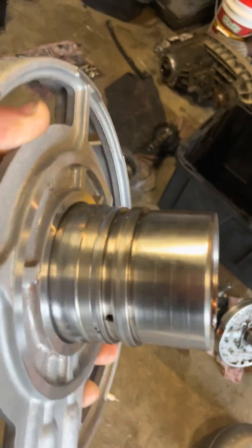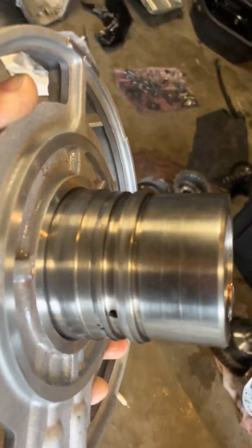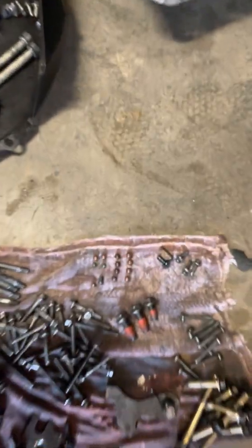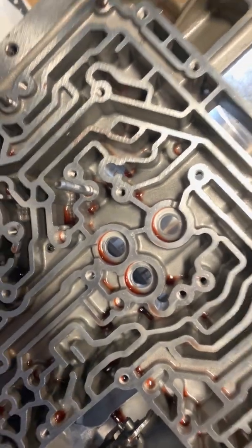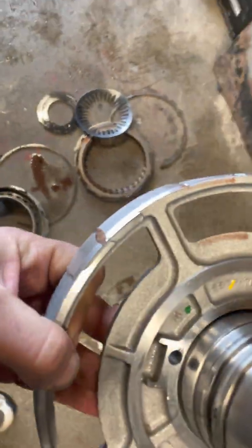When this is walking sideways, it can cause a lack of sealing, and you'll know if you tear into the tranny and you find that these three bolts, which are really just oil passages for those clutches, if you take them out of there and you find that they're not even making contact, they're letting that whole center carrier move around, you've got this problem going on where that carrier, those parts I was showing you, are worn so badly, and especially opposite the bolts.